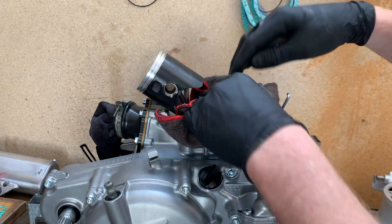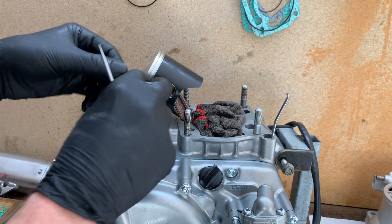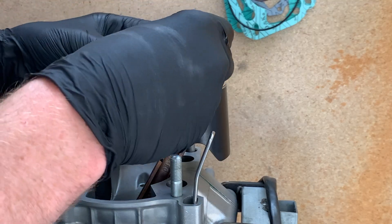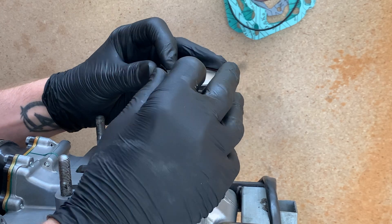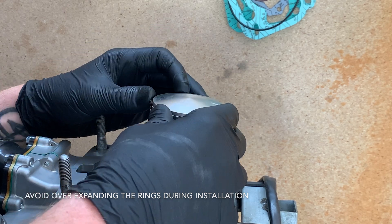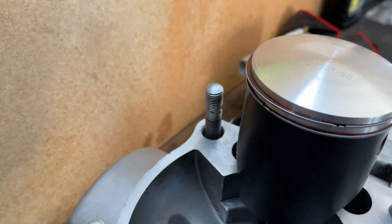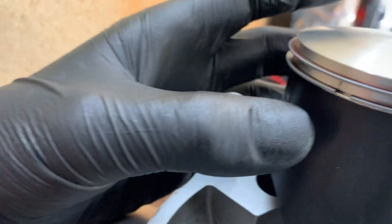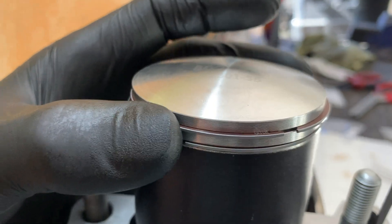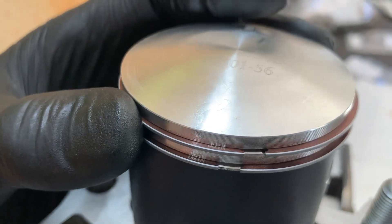To lower the chances of dropping the second circlip into the engine, it's a good idea to stuff a rag down here. The piston is installed on the rod and the ring is installed on the piston. Just make sure that the open end lines up with those pins that are located in a two-stroke piston — you can see there it stops the rings from spinning while the engine's in operation. Also as the cylinder goes on you need to make sure that these rings aren't getting caught on top of that pin. Both numbers facing up — good to go.